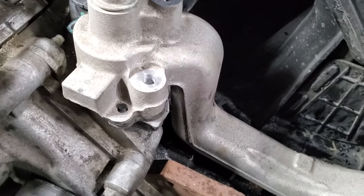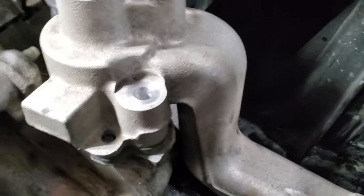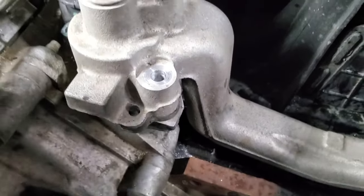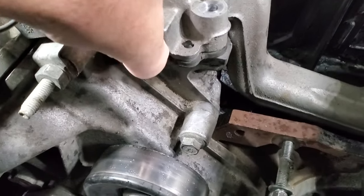There is enough room. If you actually get it loose, you can push this guy back a bit and actually make a little bit of room. You end up just filing away just a tiny bit of that little overcasting, that 90-degree part. That makes it so that now, when you go to slide this guy forward, it will actually come out.